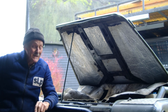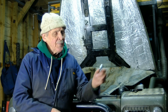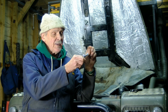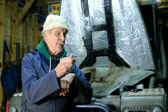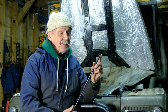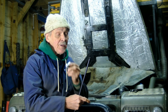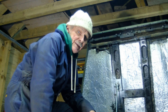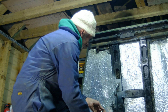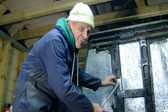That meant I had to start looking at the angles and tolerances in rather more detail. Looking at the hardware, we've got a right-angled ball joint, obviously designed to operate within its working range, but it's not that great — it only goes about plus or minus 20 degrees. If we look at a typical 50 kilogram strut, the end portion is threaded at M8, which is really not very strong. So if this goes out of range and starts putting bending into the arm, you're going to have a failure. We now need to talk about the design of the upper bracket.